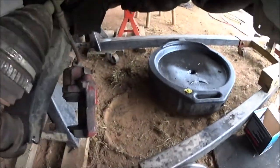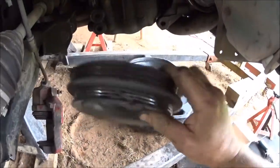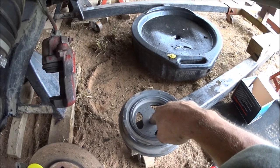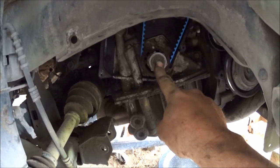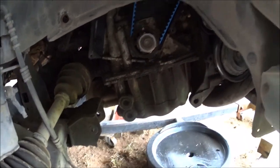We're going to get our covers back on. When I install the dampener I usually hit it in the middle with a rubber mallet and drive it on as far as possible before trying to pull it on with the bolt — I don't want to do that because you could stretch the threads. It's one of those things you just have to wait and see.